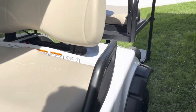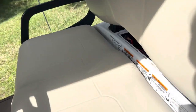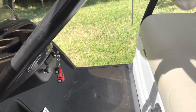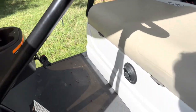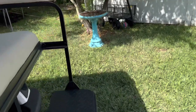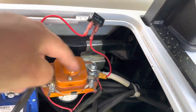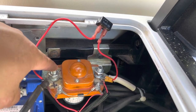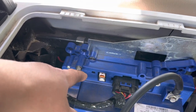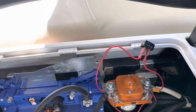Before we had nothing - no backup, no backup horns, no alarms, nothing. As soon as I got power I was like okay, something's working. The lights have always worked so that's not a real good indicator on these if something's wrong. That's when I came back here and started digging around. I had 51 volts, 51, 51, 51, but when I hit the gas this would go down to 40. There's a little indicator light here.